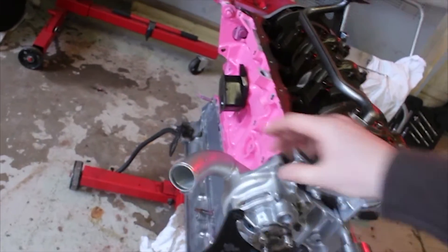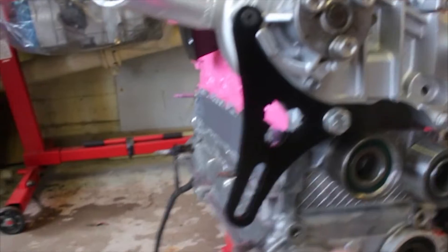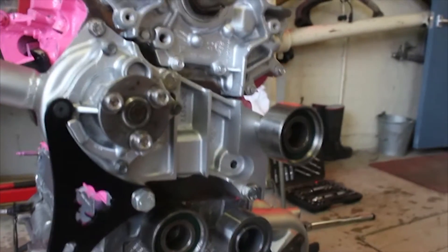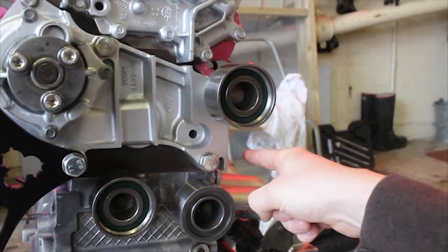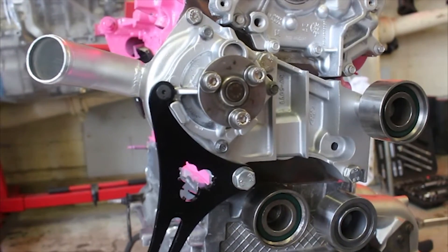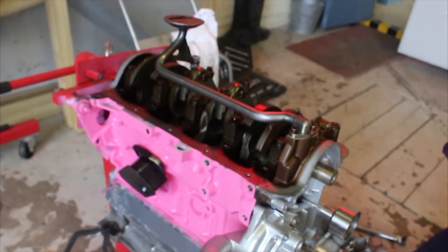We just TIG welded a bent pipe on that with a little swaged end. We've got the legendary cock and balls bracket for the idler tensioner, and we've also put some metal idler pulleys on the water pump housing to reroute the water pipe to clear our Ike engineering thermostat rail and water rail that comes in underneath the inlet manifold. Once we got all that buttoned up, we popped the sump back on and put all the pulleys on.